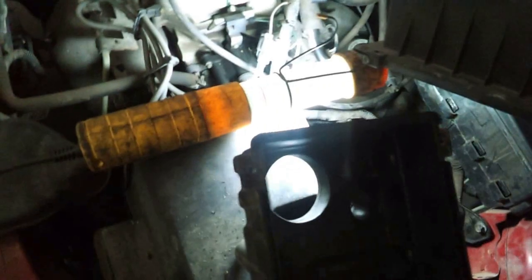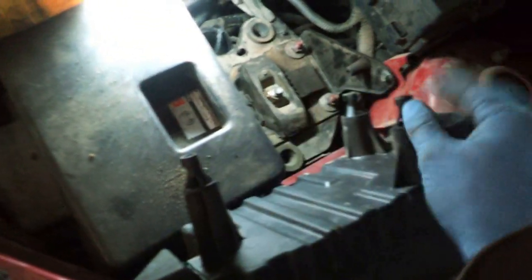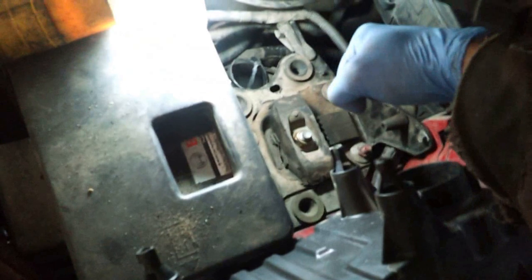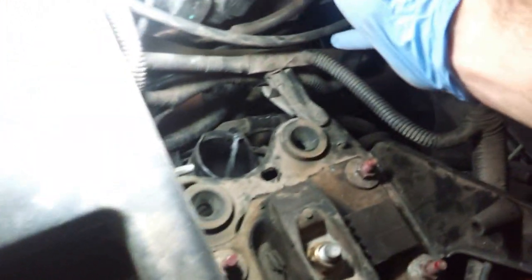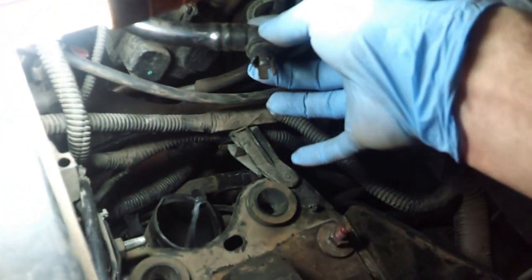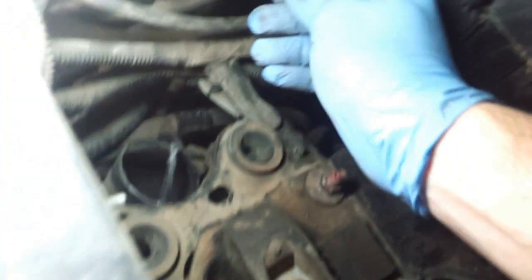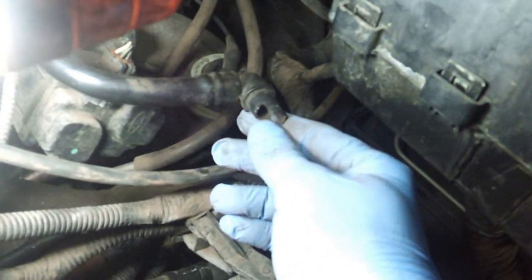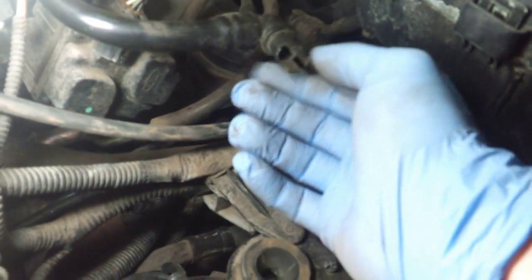And then what I did next is, the housing has no bolts or anything. They're just little plastic clips, and you just grab under it and pull. It was a little hard, but with enough gusto you can get it open. One thing else to be careful of, there's also a little tube right here that hooks up on the front side, and there's like 4 little tabs. I tried to use a screwdriver and I accidentally broke one. It did help it come out, but the other 3 will hold it in. It shouldn't be too big of an issue.